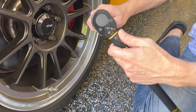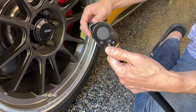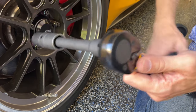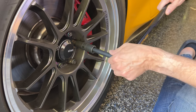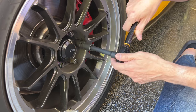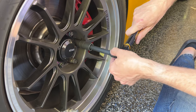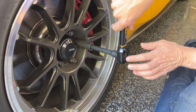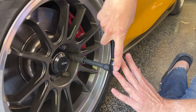The next thing I'm going to do is tighten these up to their correct value. Now your torque wrench can go two ways, so you've got this little thing over here just to flip it the correct direction. Don't worry if you haven't got it right — just flip it to what you think is the correct direction. Put this on — I'll always do this by hand, of course. Get it right on the lug. Now you can hear these little clicks going on when I move it like this. There's a little cam and a little gear in here where the teeth pop and the cam pops between the teeth.